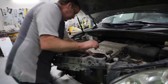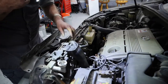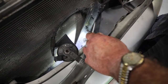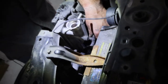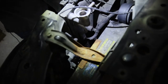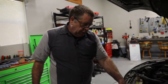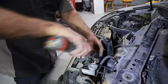Now I'm going to unplug this electrical connector right here. It got a little stubborn, so I've decided instead of pulling all these wire clips, I'll pull that one bolt down there and move this whole piece up out of the way. I'm also going to unclip this wire harness right here, which will let that move up out of the way and separate my fans from the car so I can pull the entire fan assembly out. Next we'll pull these two bolts that hold the radiator and the fan assembly together.